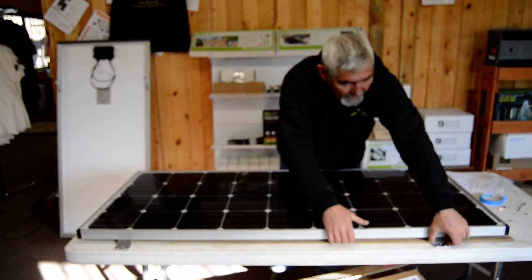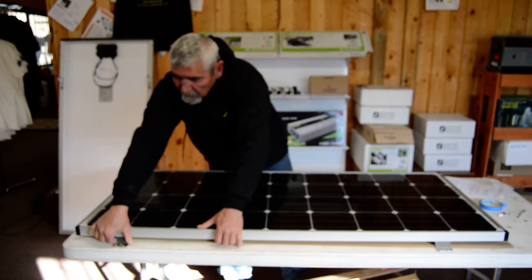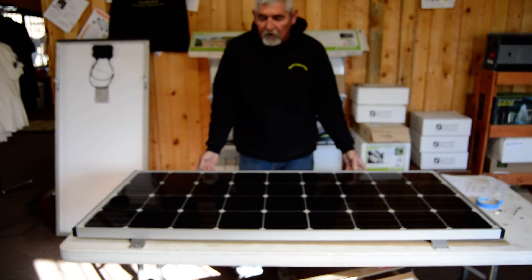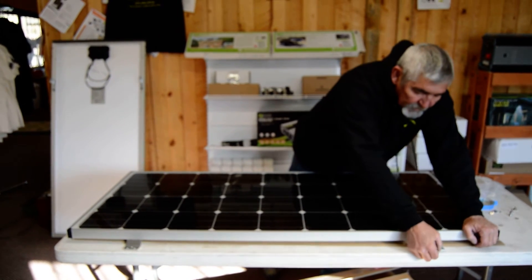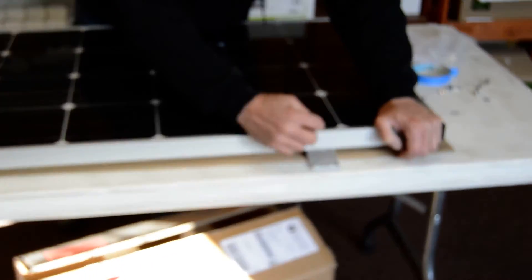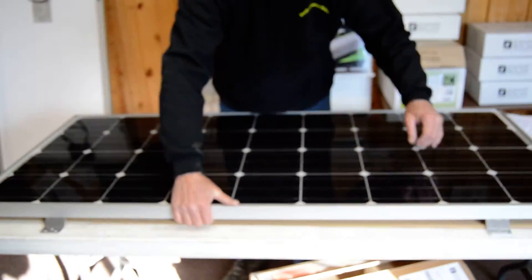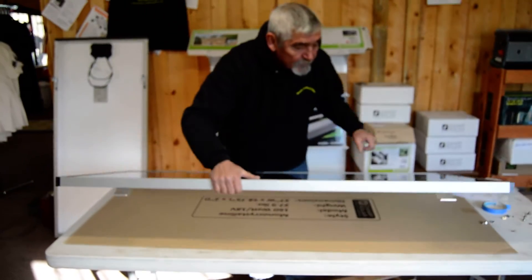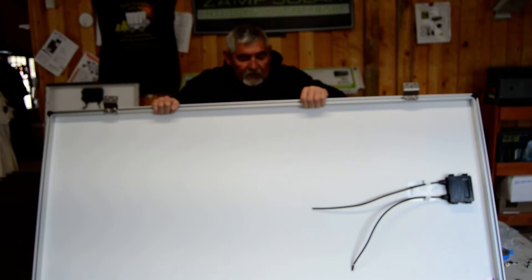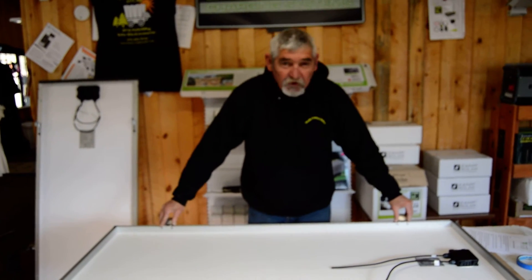At that time, you can take and slide this mount to meet your crossmember where it needs to be. Then you want to do the other side also. At that time, you want to put your little mark on your roof and the mark right here in the middle of the mount bracket and the little mark on all your feet. At which time you can remove the panel — be careful because you can tear your rubber roof with these. Take it off, tighten your mounts, then reset your panel up in place and mount it. Once you tighten these up, they're not going to go anywhere, and that makes it much easier to adjust while mounting.